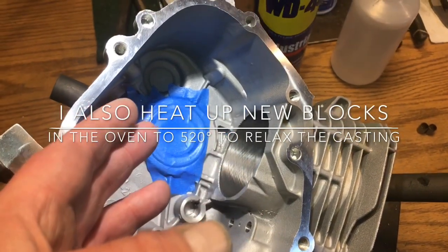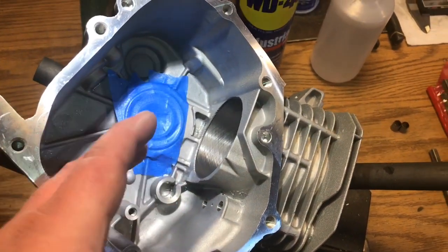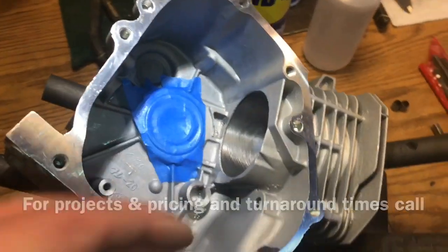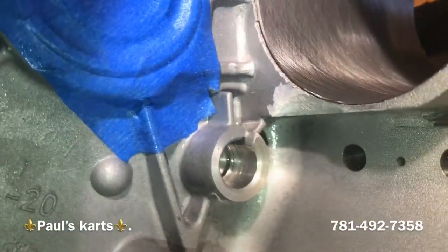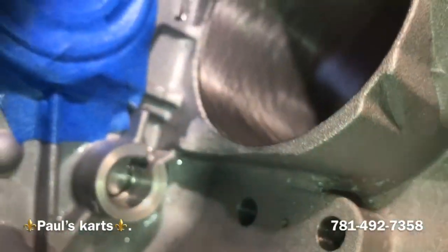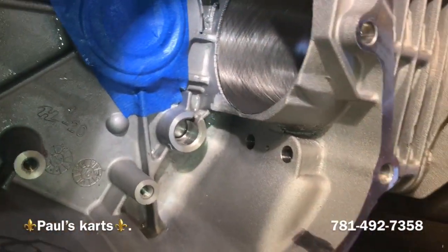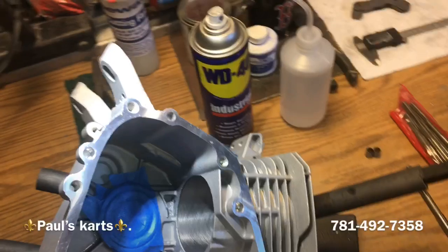Theoretically this was a new block — when I heated it I put the bearing in, though I should have waited. Nine times out of ten if you guys are doing it the bearing will probably already be in, so always take a little acetone or contact cleaner, clean around the bearing area, and tape it off really good — make sure it's sealed. Run your fingernail over it from both sides to seal the bearing, then go ahead with your block clearancing. This is how I clearance the block for the lobe — notice there are no corners. Everything is a nice rounded edge; if you run your finger over it, it's nice and smooth. You don't want any hard edges. Clean it up really good with compressed air, acetone, and WD-40.